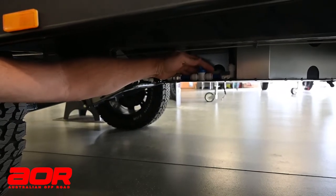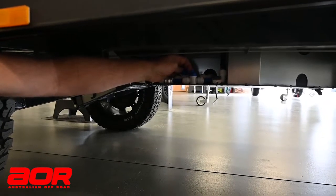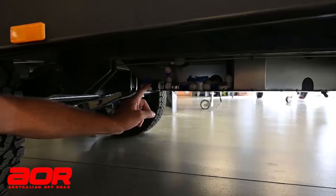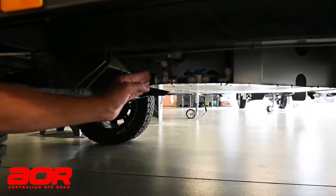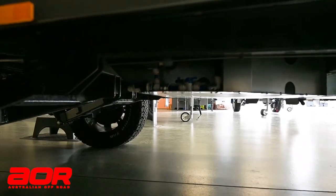So normally we'd open that there. There's another valve here behind, and I turn that one to the off position — so that's going back this way now — and I can open that up. I no longer have any more water pouring out there. So what I've done there is I've bypassed the tank completely. It's going back up to feed the water to our shower — it doesn't go into the tanks, you can't fill the tanks with it there. It's only to be able to give you water on the shower side.